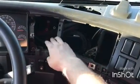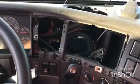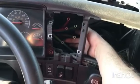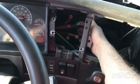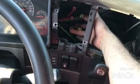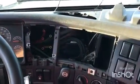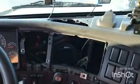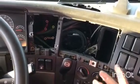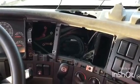So as you see, the hoses definitely stayed in the form and shape that they should. So I'm just gonna go ahead and snap them on. Since I'm working from here, I'm gonna do the brown first, then the red, and then this red, then green and yellow, whatever, it's easier. But I'm definitely gonna start from this end, and we'll see how it's gonna work out. But basically that's all. Everything is gonna snap back in as it came. Don't use any force. If you're using force, you're probably not doing something right.